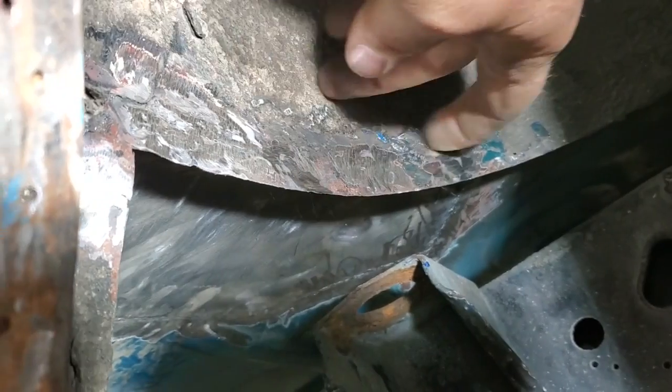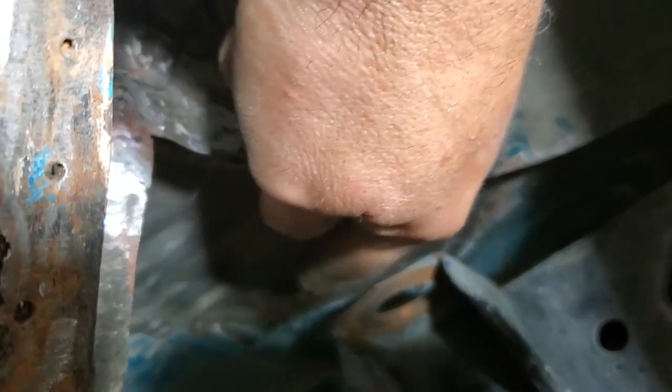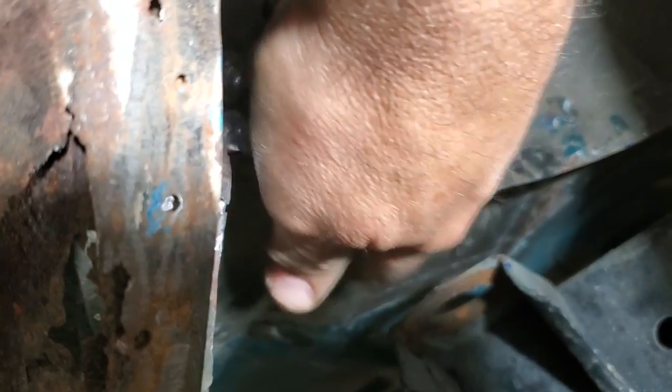So I had welded all that up there and I ground off all the spot welds and everything. And I went in here then and ground all that down, cleaned all that up. I'm not going to bother to weld the back side on this. I got good penetration and everything on it. And the mount is going to cover a lot of that down there anyway when the mount gets made. So I've got this done now and everything's done, so that floor pan is finished.